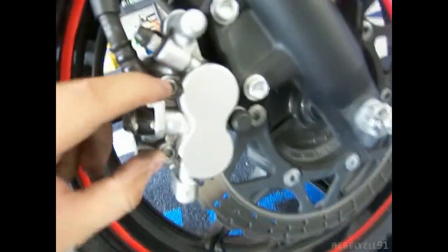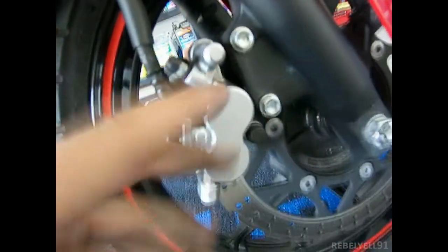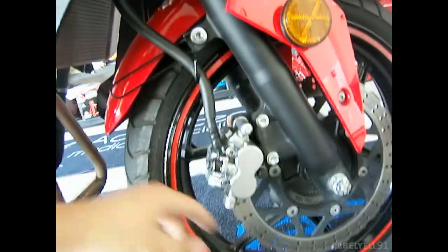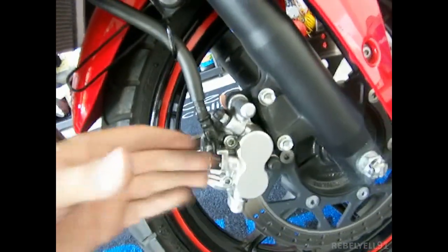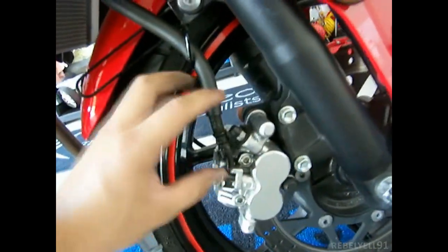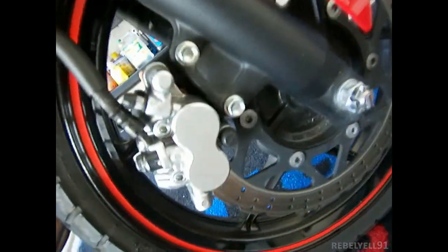This is what you do. You loosen up the two shafts, they're mounting shafts, I believe they're called. You just loosen them up, they'll come out in just a bit. You completely take off these bolts, and take the caliper off the rotor. I like to let it hang from this, because the service manual says to detach it and everything. So you have the caliper hang. After that, you take out the mounting shafts, they come completely out, and your pads will practically fall out.